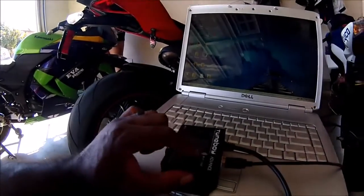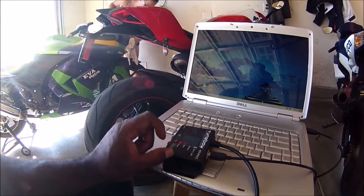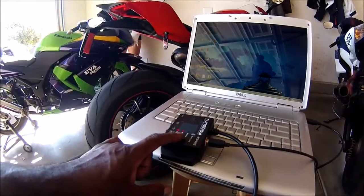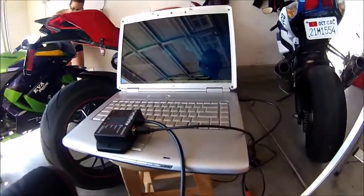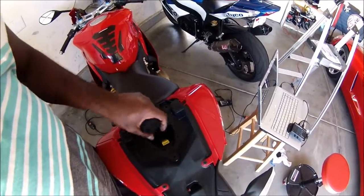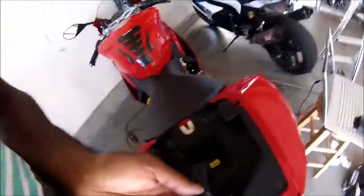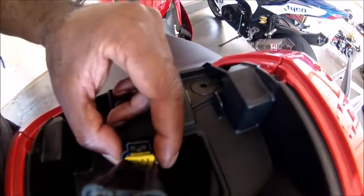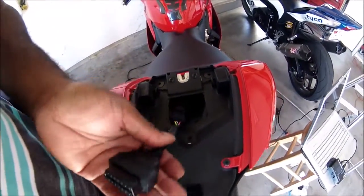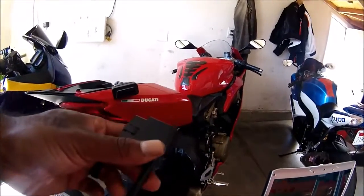As you can see, you have Wi-Fi — you can do Wi-Fi, and that's for data logging. There's a vehicle light that comes on once I connect it to the motorcycle, an MTS light, and a power light. The MTS blinks and the power light stays solid once it's connected to the computer. The ECU is located beneath the seat, but you don't have to take the seat off — they have a convenient port right here. That's how you connect it to the ECU.